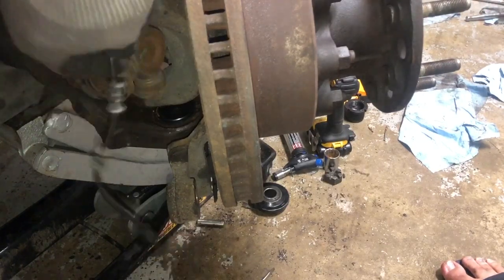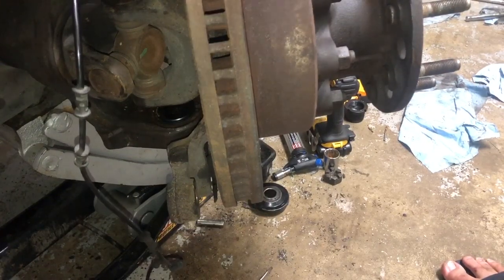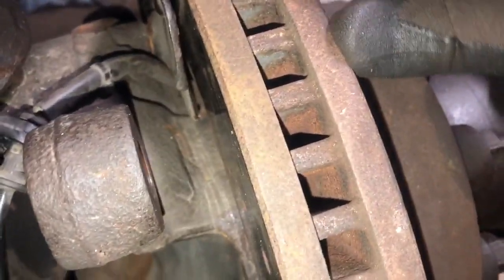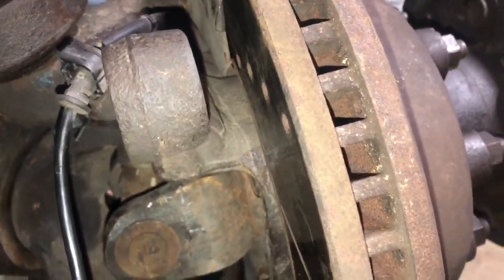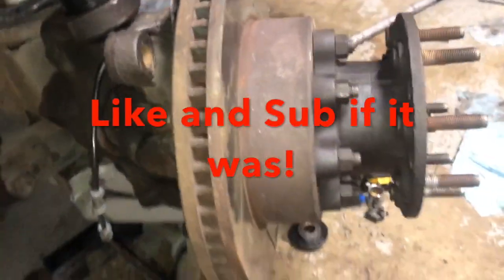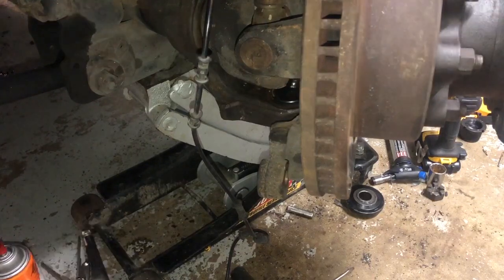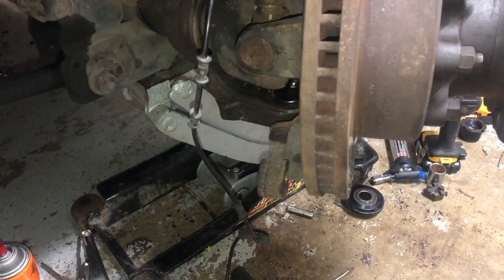One other thing to make sure: the wheel hub assembly line — make sure it's out of the way and underneath the shield so you don't accidentally get that thing cut by your rotor going back and forth. With that, you should be in business. This will wrap it up for this video. I hope this was a help to you and hope you are safe out on the road. Do everything slowly when you're going at this project to get these ball joints replaced. The links in the description will be there for the stuff I'm using. Hope this helped — have a great day, God bless, and we'll talk to you later.